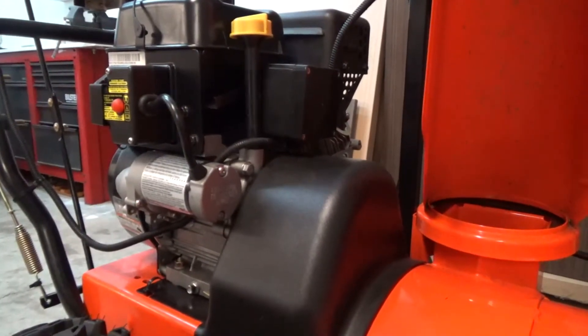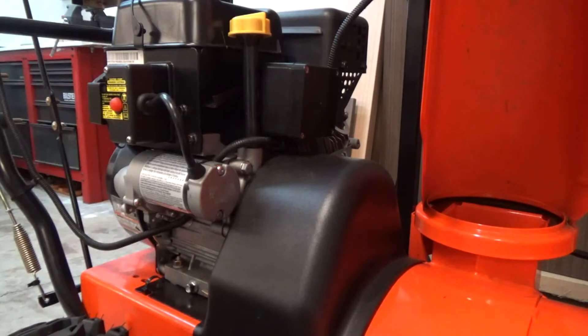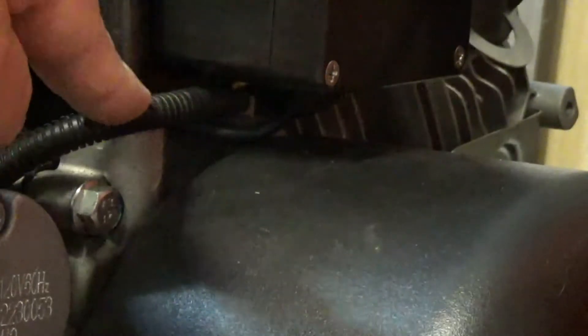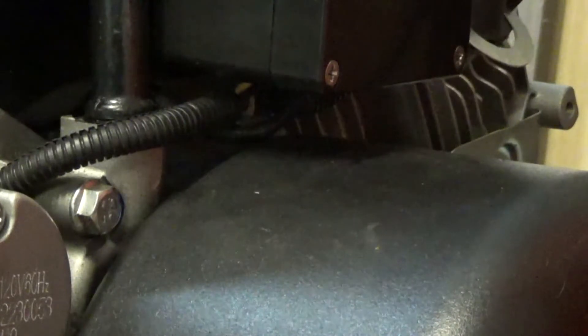So, in order to make it work, I put this little black box here, and now the light works. Well, sort of. I actually left the original light connected to the generator coming out of here. This is the OEM wiring to the original light, and this is the generator wire coming out of the engine — so that's AC. Normally this wire connects directly to that wire, but I unplugged them and rigged it up so that both lights work.